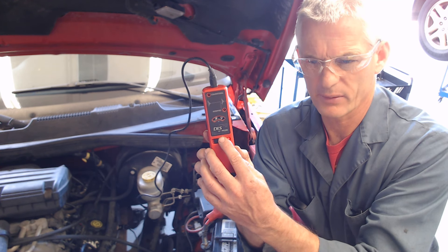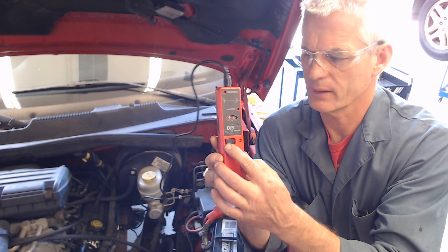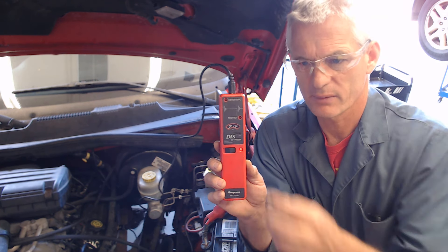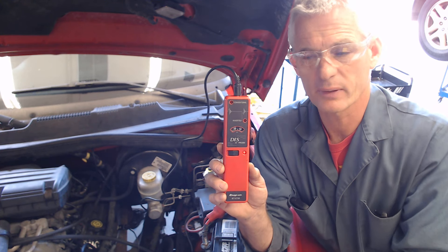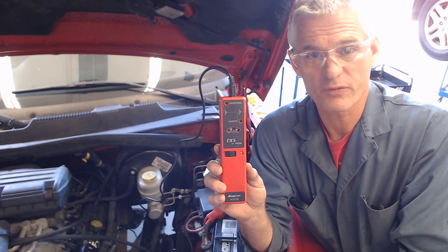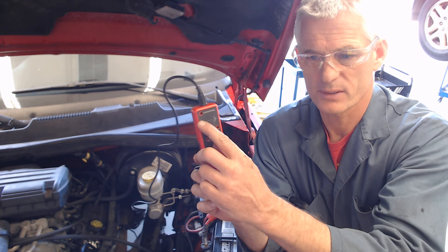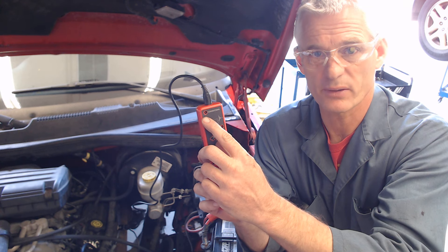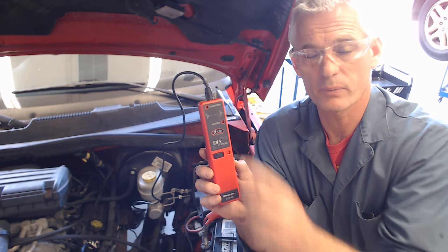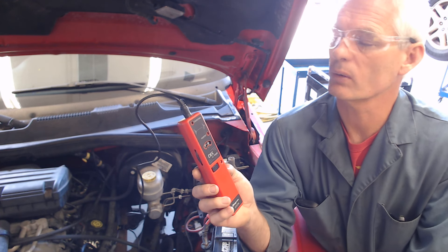This has a 9-volt battery in it. Shut it off, turn it on — you can see that red light right there light up. This says conventional, this says inverted. Conventional is on a regular ignition coil engine where we have spark plug wires and we're firing center to side electrode. If we have a DIS car, some cylinders will fire conventional center to side and some will fire inverted, which is side to center. This one is not a DIS — it's just a single coil car.